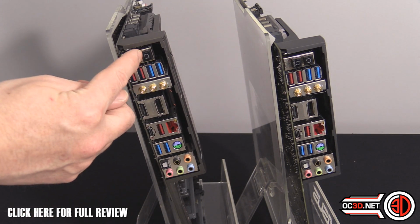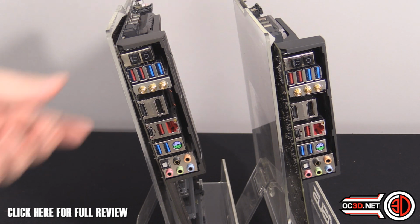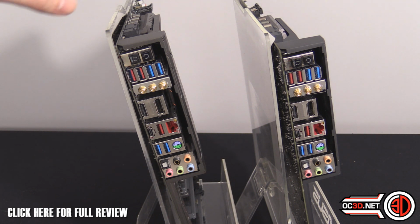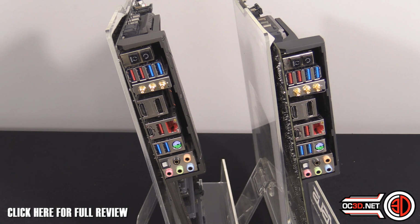And then you have a BIOS clear button, and then you've got the BIOS flashback button as well, which is really handy because with the BIOS flashback button you can chuck a USB stick in with the latest BIOS on it, and even without having a CPU in, just having power to the board, you can press the BIOS flashback button and it will update your BIOS without actually having to boot the system.